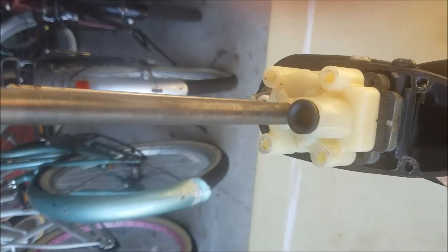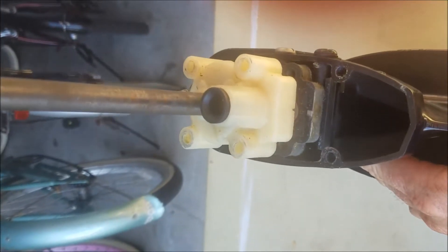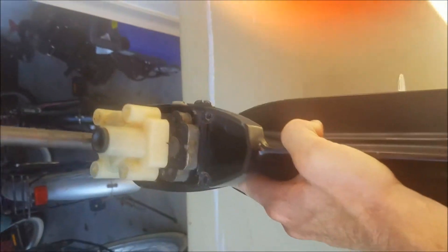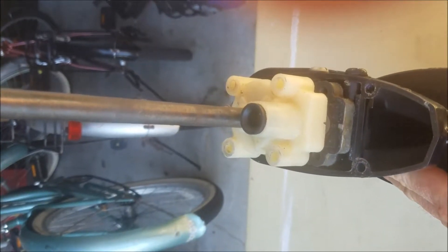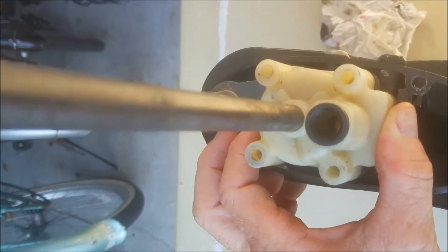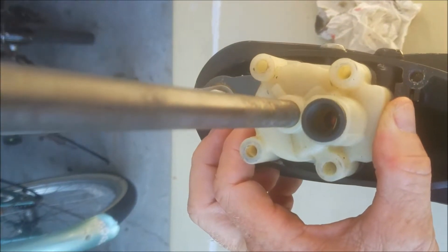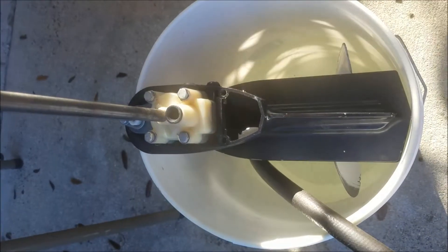Now I'm going to put the water pump housing top back on. What you want to do — and I can't demonstrate on video because I need two hands — is turn the shaft clockwise as you're lightly pushing down on the water pump housing. The propeller will be facing you as you do this. Once I've got the housing in place, I'll put the bolts back in with a little grease on the threads so they don't seize to the foot.